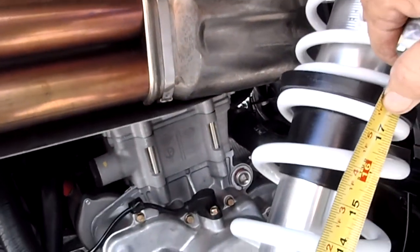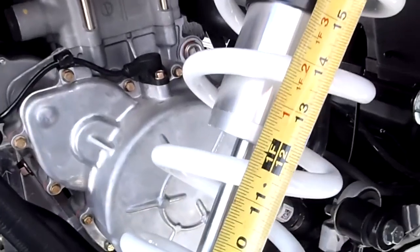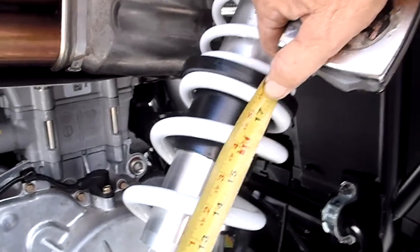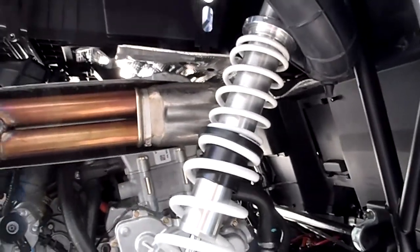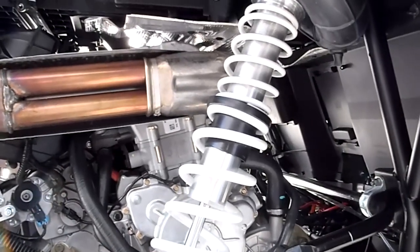The shortest main spring you're going to be able to put on, like I'm showing, this is drooped out all the way. All the preload is out, and you'll see 14 inches probably the shortest I would go. I mean, you could put 2 12s, which would be 24, and run them off that collar, which I don't like to do. You could put 2 14-inch springs on here, and you could really play with that way. A main tender setup and a collar in there.